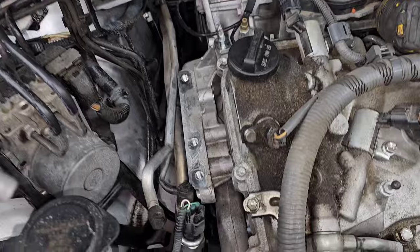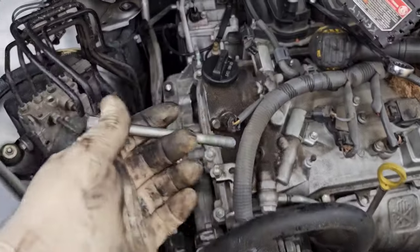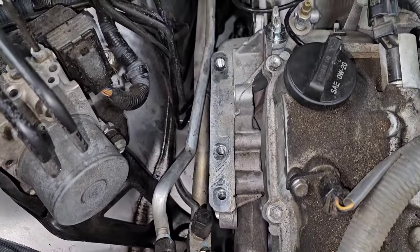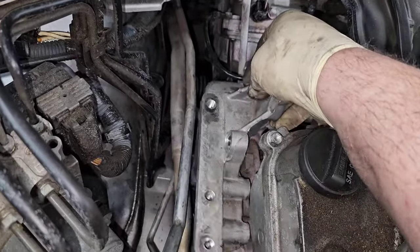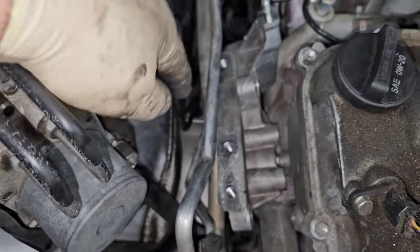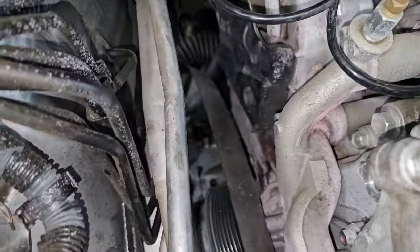It turns out there are six bolts that hold this thing in, and the two bottom rear ones are a real pain in the neck. I got the mount out on the bottom on that side, and I got the motor jacked up a little bit. I was able to finagle these bolts out in between the AC lines and the brake lines. You do have to bend the AC lines a little bit to get them out, but the bolts did come out. Now, how does this bracket come out? I moved the lines over, and then the bracket comes up and out because that bottom part has to get around that housing there.